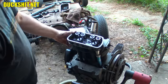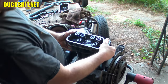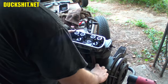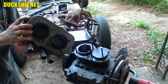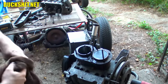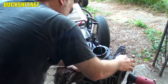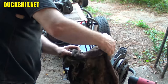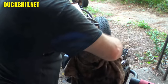Got a drip pan down here underneath. This one's going to lift off pretty easy — it's going to take the cylinders with it. That's what I was waiting for. Got the oil out of the head. A little oil in the cylinder, but that's from standing it upright. I was careful when I turned the flywheel — that's how I ripped my pinky off when I was a kid. Minimal scuff marks in there. What was there was just oil run — a little bit of oil in the cylinders from standing the engine up to test for leaks, which is to be expected. The stuff will leach around the rings.